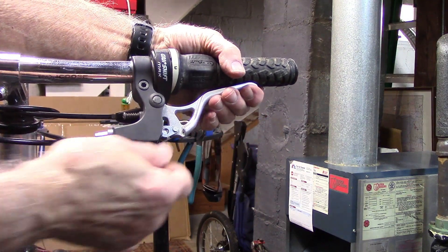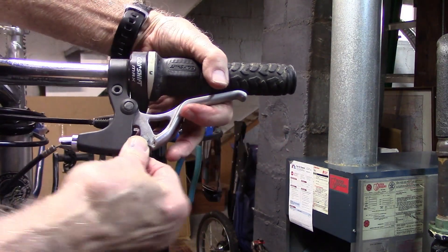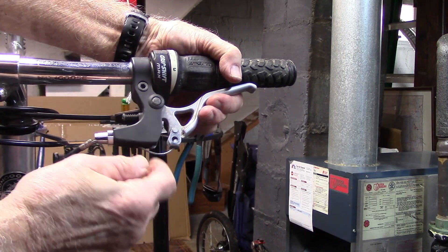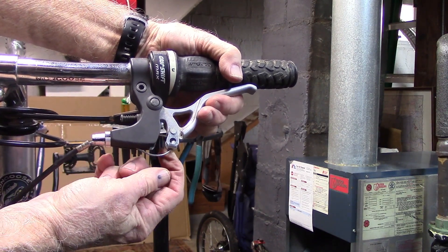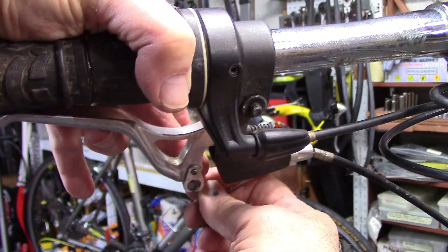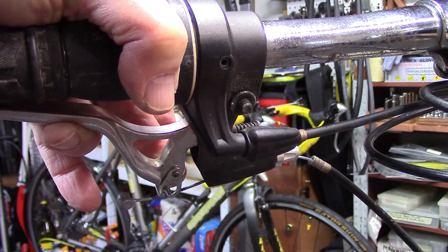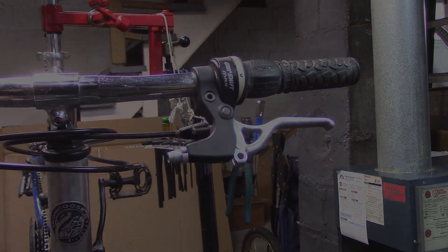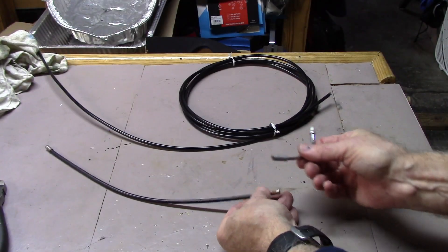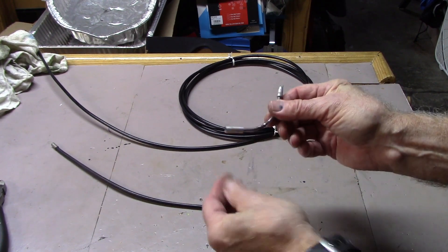Our next step, we're going to close the brake handle. When we pull this down, on the other side is a small groove through which we'll pull the cable. Now we can remove the cable and the housing, and we'll remove the noodle. Some people will clean this with degreaser, but I think this is pretty well shot and we'll go ahead and replace that.